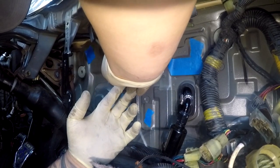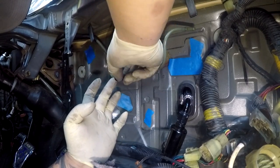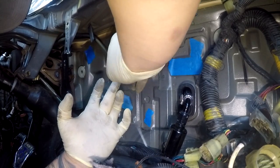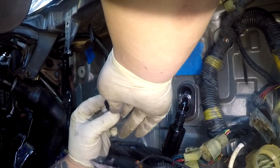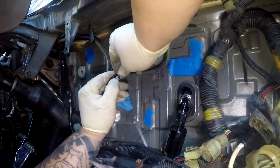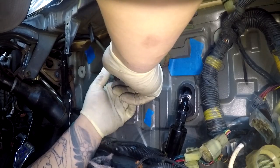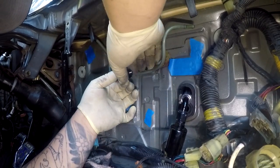So with this fitting, you pretty much just put the tube nut in, and then you put your compression ring, space it in there enough, and then you take your other end fitting here, and pretty much you just screw them together, and it will compress the hard line, then converting this line to accept a -6. So right there it stopped.